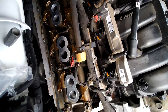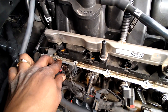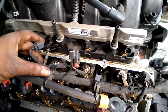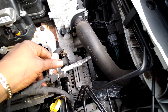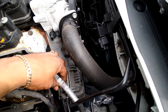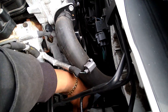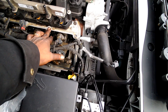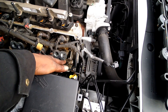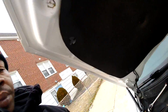Here are the injector wires — the injectors — you gotta disconnect the injectors, and then you have your coils. You might have a temperature switch here, and this goes up to the throttle body. Basically everything is 10 millimeter. The valve cover gasket itself is 8 millimeter, the coils are 10 millimeter. Then you disconnect everything and you'll be happy with it.